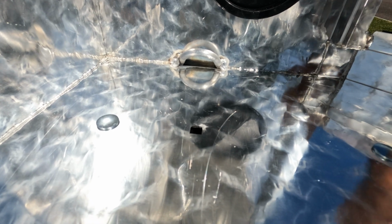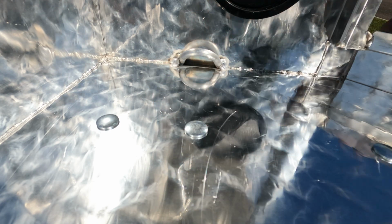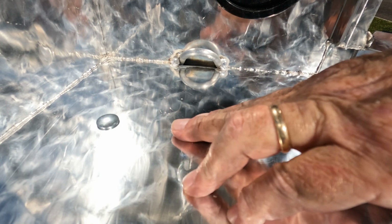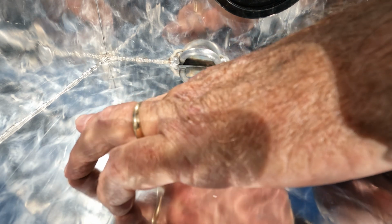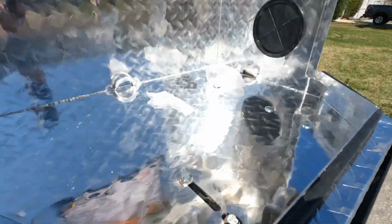You're going to take the 8 bolts that they provide you. They're going to go into these holes that are pre-drilled, pre-set up to go through the box and the tray. Once you put them through, you're going to put a nut and a washer on the back side of it. And you've got 4 of these on each side that you're going to put in. After you have those installed, go ahead and put your 2 bolts back into your front brace and tighten them down so that it's secure.